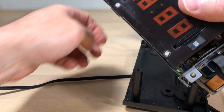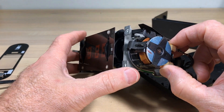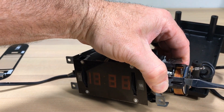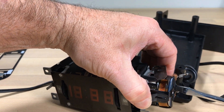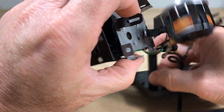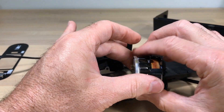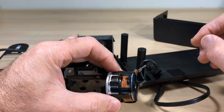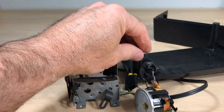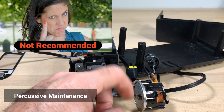Here we have what's called a General Time Capsule motor, which is obviously at fault. To remove these motors, push in on the tabs a little bit and then release it — just squeeze in there and it lifts right away. You've got a coil and a magnetic field that impacts the capsule part — the aluminum can. Let's energize it: you can see it is not turning. I'd be very cautious here as there are open areas where you could get electrocuted. It's clearly not working.